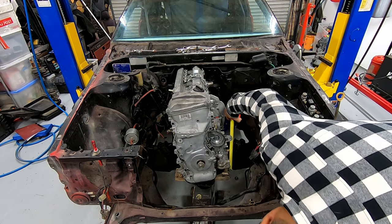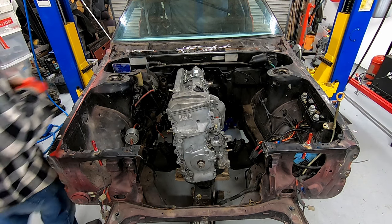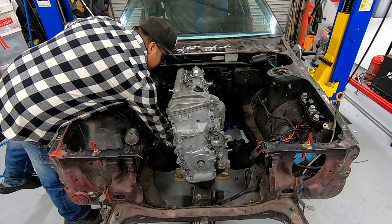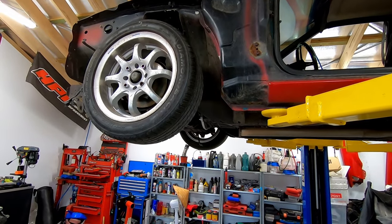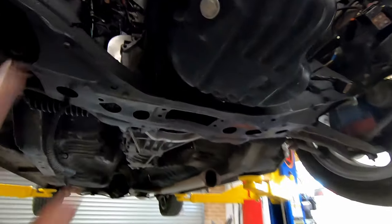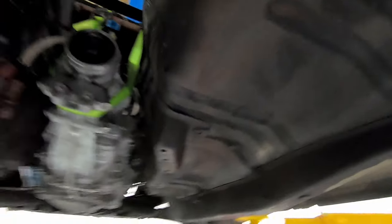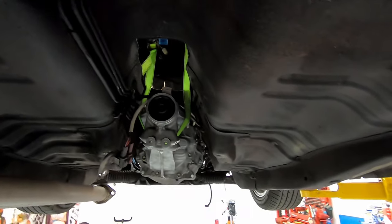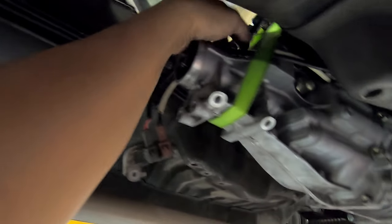Having more weight over the front of the axle will negatively impact the balance of the car. In my case the front axle line is between number two and three cylinder — close, but not as far back as I'd like. This is due to the physical size of the bell housing. Underneath the car we've got plenty of clearance for the subframe, and the tunnel is actually big enough to fit the whole transmission in. The shifter comes out probably 15 centimeters back from the original position, but that's okay because we're going to use the remote shifter and move that forward.